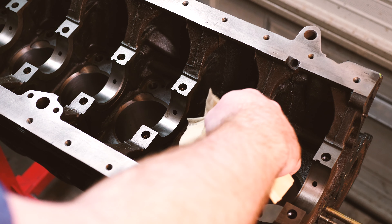The rest of the bearings are going to install exactly the same way as the center one, so I'm going to go ahead and continue installing those now. I'm making sure that the bearings are centered in the journals — making sure one side is not sticking up higher than the other. Then I'm going to wipe them down one more time with the tack cloth to make sure there's no dust before doing the bearing measurements. I'm going to do the same thing to the crankshaft off camera — wipe down all the journals, making sure there's no dust or lint. Now I'm going to carefully set the crankshaft into the engine, making sure I don't ding any of the journals on the sharp edges.